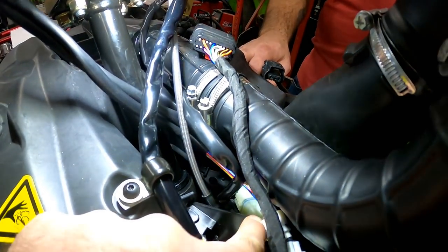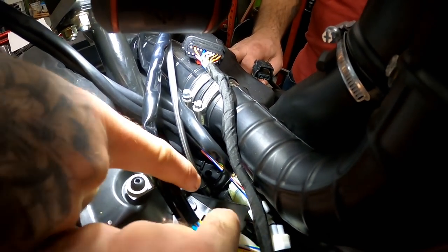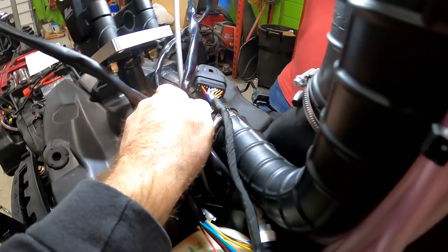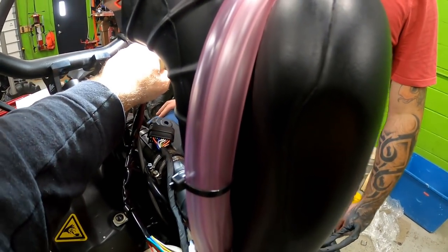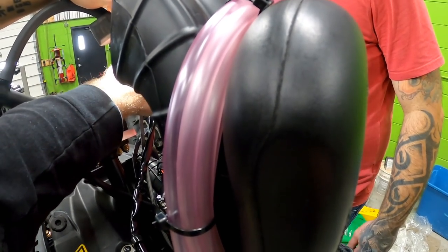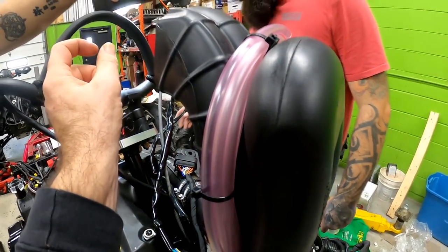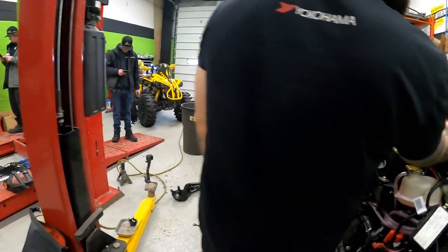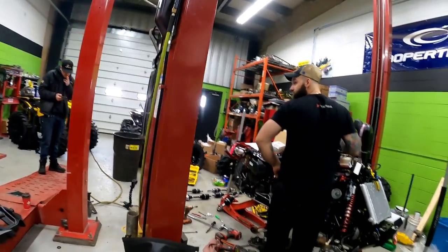I pulled that out, but if you've gone in there, the junk from those lines hits the bottom of this bracket. It only gives you that about all you got. You pull it out and rotate it down. I've done that as well, but you also just want to loosen up here and bring the whole reservoir in. It's a couple ways to pull in a little bit of slack. I mean, there's not much to work with, boys.